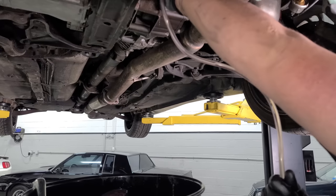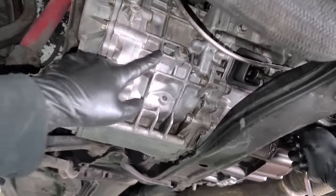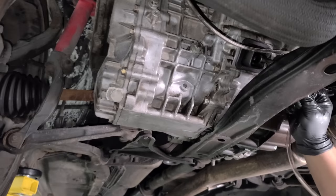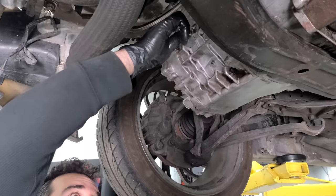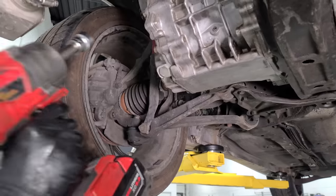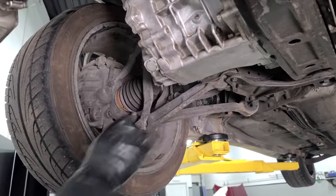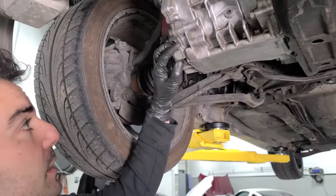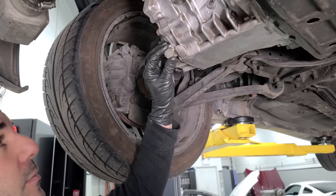Cool, that fluid just looks so much better. And you know what? It's just so easy to swap out all these fluids, you might as well just do it every so often. All right, we're gonna check this transmission out. This is also 75W90 weight gear oil. This transmission feels buttery smooth. Everything feels great. So in other words, I don't expect any weirdness from our transmission. Please no weirdness. Please no goopy stuff. Here we go.